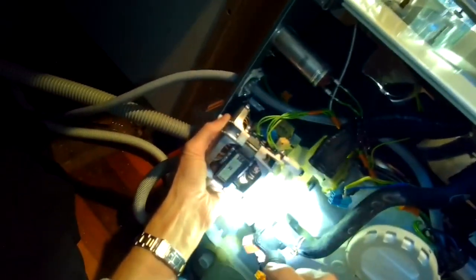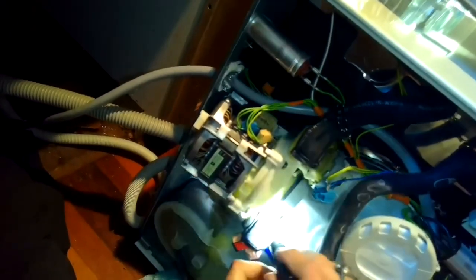And then I'm going to use a standard head screwdriver to help me gently pry the back of the circulation motor out of the back of the dishwasher. I'm going to pull it out at about 45 degrees. Just take your time here. Don't rush. Standard head screwdriver, just using like a pry bar to help you get the back of it to move, and it'll come out. Yeah, just take your time. Wiggle it out. Make sure you have all of your connections off.